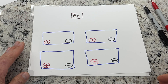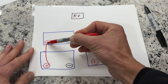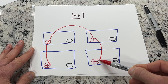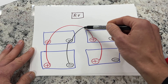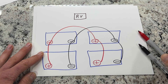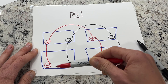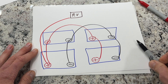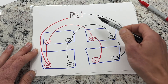For the four-battery setup with the same question: take your batteries and connect them all in parallel — doing the positives first, then connect the negatives in parallel. Once the batteries are connected, then connect the batteries to the RV. Same as a single battery — connect the positive first to the RV, and then the negative. If you were disconnecting it, you would do everything in reverse order.